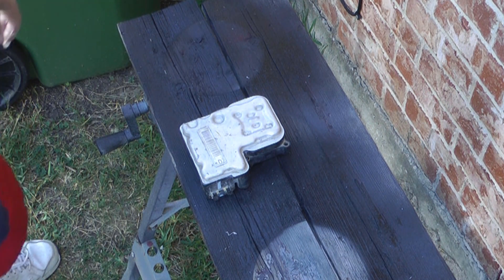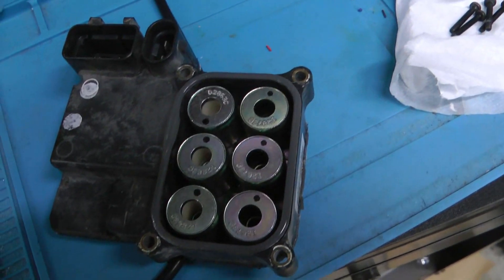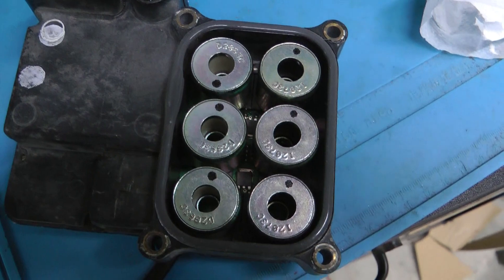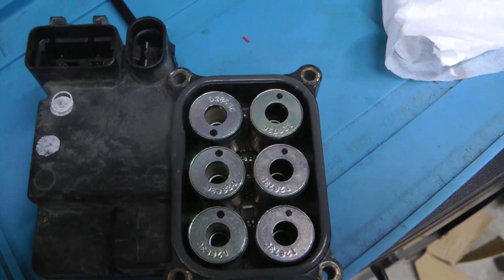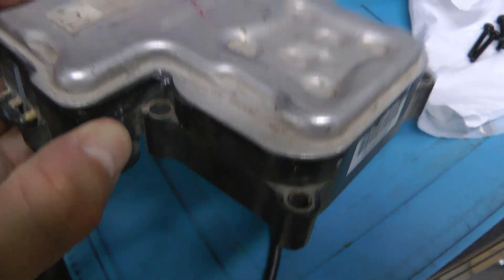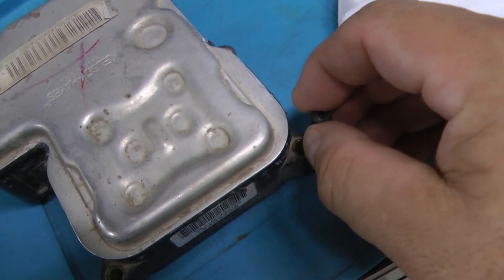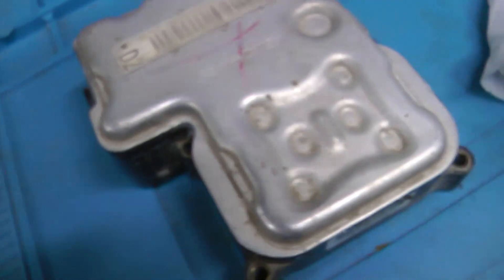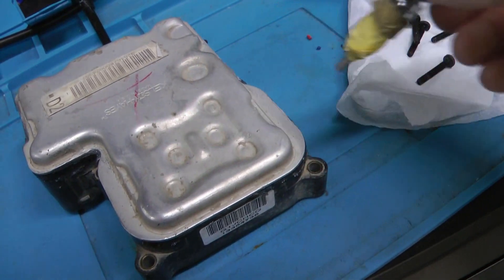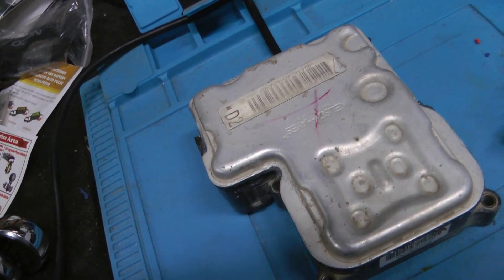Just let that dry overnight. I'm going to go ahead and reinstall this on the truck. My initial plan of only using one or two bolts has been foiled because this is a gasket right here, so it's going to need equal clamping force on all four locations — unfortunately that's going to be a pain. I'm not going to be able to film it because it's in a spot where you can't really see what I'm doing. Basically I'm laying this back over where it goes and then putting these bolts in and tightening them down. It's kind of a blind operation — some places I can use a socket, some places I was literally having to use something like this with a bit on it. Not a great location for filming.